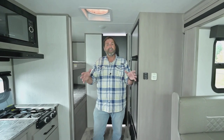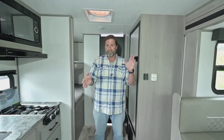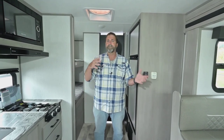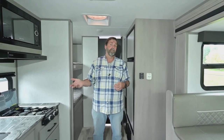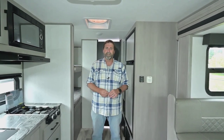One last thing on this coach I wanted to mention: it has a torsion axle, which means independent suspension. The trailer tows great, especially on rougher roads and bumps — it doesn't transmit torque and flex to the trailer the way a straight axle does. This is a big advancement, and this thing is just loaded with good ideas.